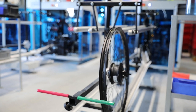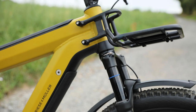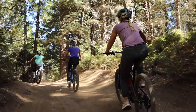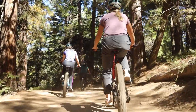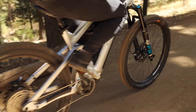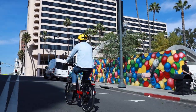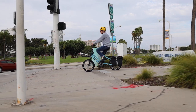Thinking about the tires, you probably want to consider the rims as well — going with a wider rim, specifically a double-wall aluminum rim, which is pretty standard these days and is going to be heavier duty. Then thinking about the wheel overall, details like the axles: many bikes might have a standard quick-release axle, whereas having a through axle — something you'd more commonly find on a mountain bike — is generally going to be a little bit heavier duty. A lot of electric bike manufacturers think about their bikes starting with standards developed for mountain biking, because e-bikes are quite often going to be subjected to stronger forces — you'll climb hills you might not otherwise climb and go down them potentially at higher speeds. So having heavy-duty brakes, wheels, and tires is fitting for an electric bike, especially for a heavier rider.